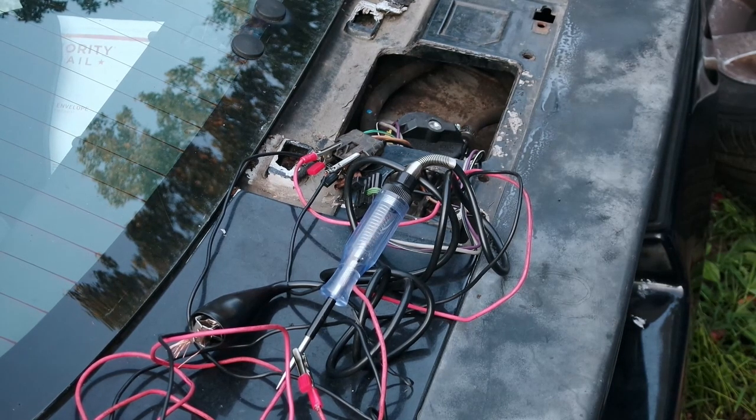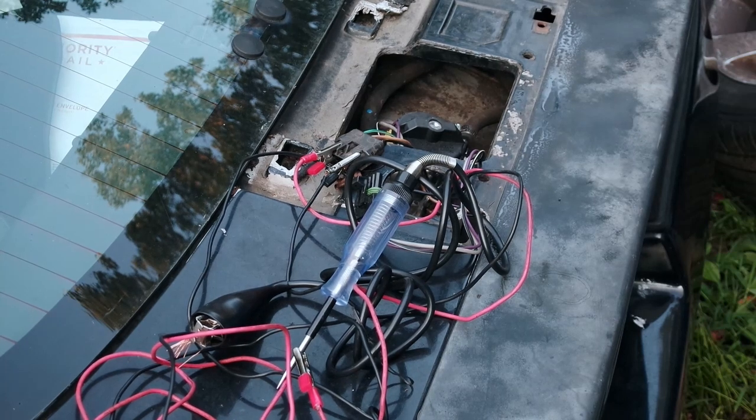In the run position you see the light came on and then went out. Now cranking — as you can see it came on while I was cranking it. So we know now that what's wrong with this C4 is it has a bad fuel pump, and I happen to have one, so let's replace it.